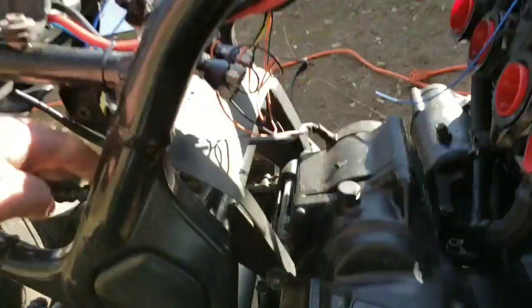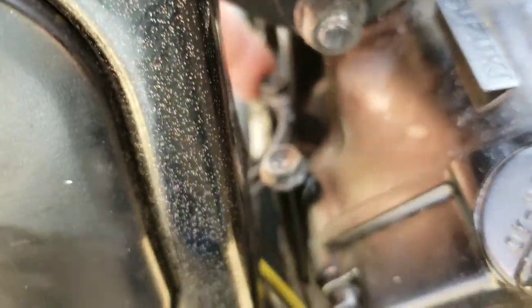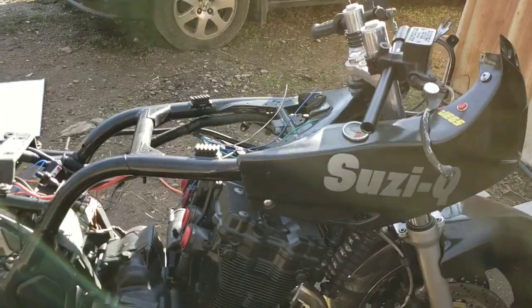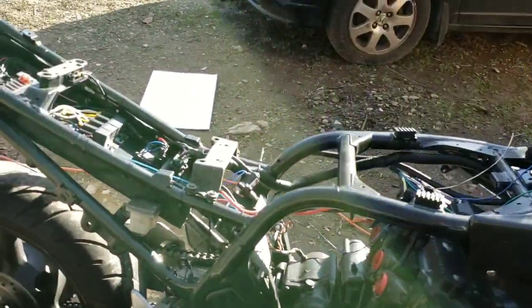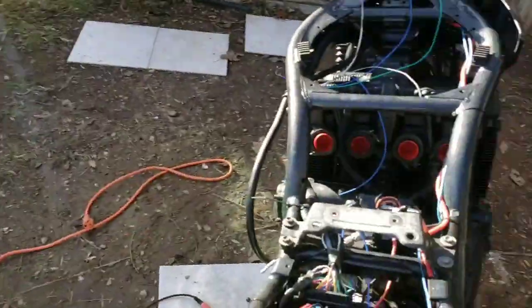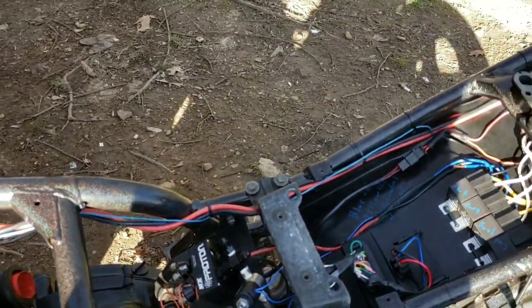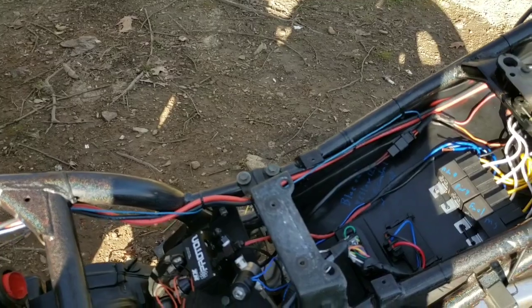And oh, yep, we got 2 wires coming down here for engine ground. They are where the original ground point was. We'll also have to run a wire back from back there to there to ground out the ignition system. All this cold shrink, I'm probably going to have to go get another roll, because I'm finding more and more things I forgot to pull before I loomed it. Kind of a given. I shouldn't have loomed it till it ran, but